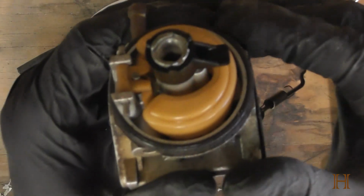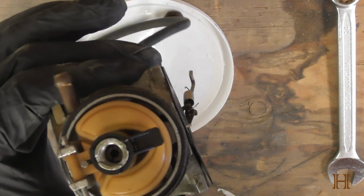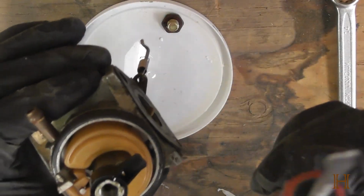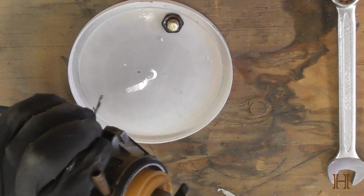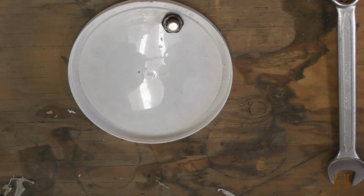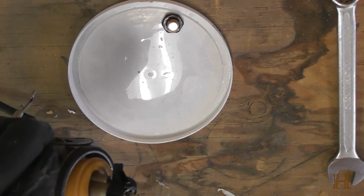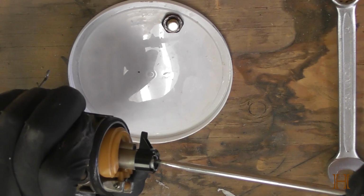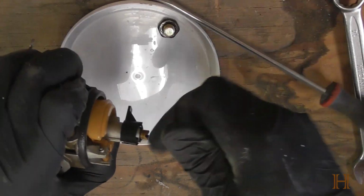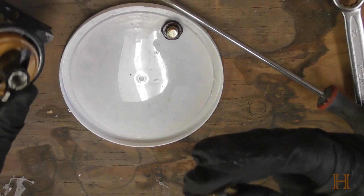And then if you look at the carburetor, so this is your float, you got your needle, and in here, I'm not quite sure what it's called. I think it's the Venturi tube, don't quote me, but there is a jet inside of here. So take a flathead screwdriver, go in and just gently unscrew it. See, I might need a bigger size screwdriver. See if this one works. That one works better. And just slowly unscrew the jet till it comes out. There we go. That basically took the whole assembly out.